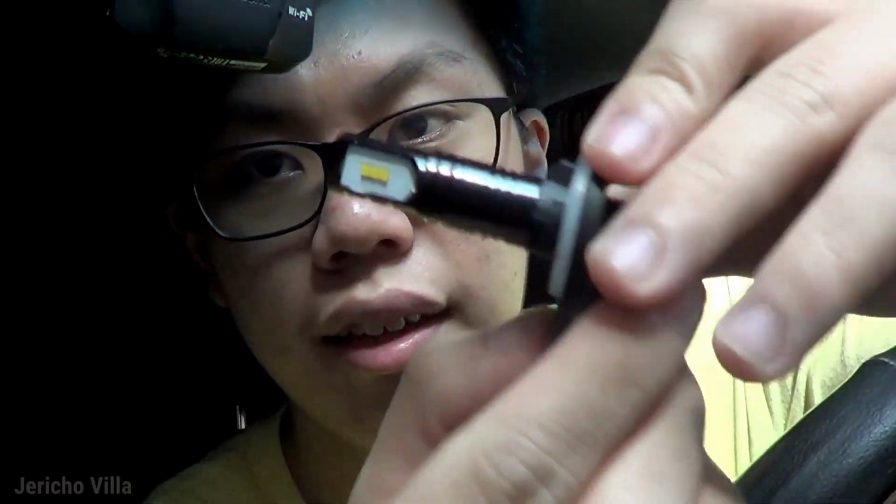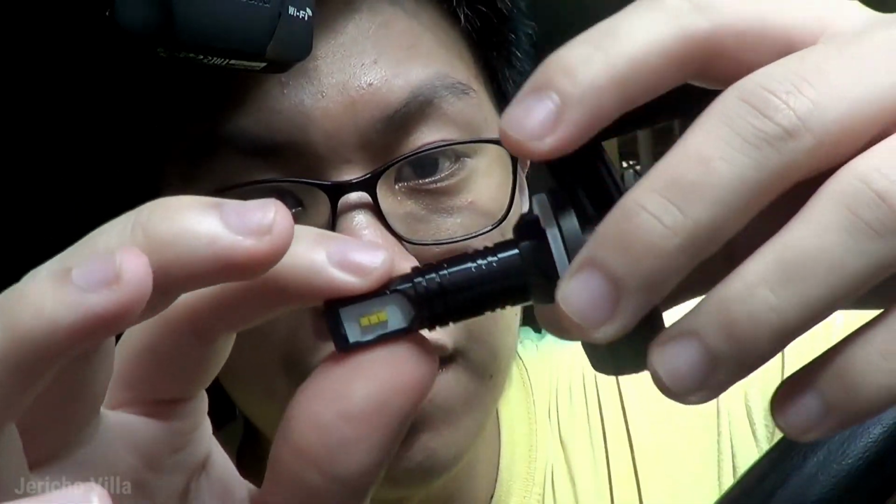So, first impressions, it's very solidly built. The dimensions are pretty similar to the stock halogen bulb, which I will be showing you in a few moments. It's also fanless. If you remember my previous video on the Fortuner's fog light, you can check it out here. I prefer fanless bulbs for fog lights, and this one looks good as well. So these bulbs are AUXITO 881 bulbs. They use the 881 bulb socket. 881 is also known as H27. Hyundai uses 881 sockets standard for their cars.